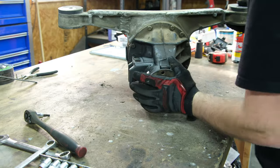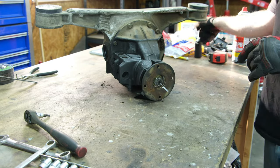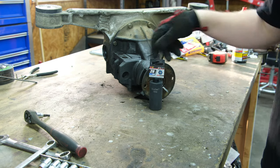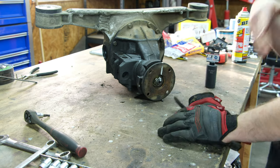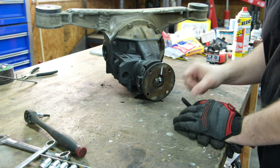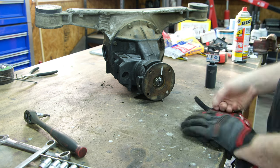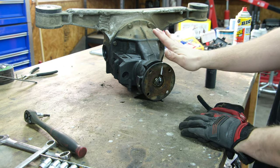All right, so back on to Big Bertha. I got a 26 millimeter socket from O'Reilly's, and it fits. So the plan is, once we put it back on, to not go past this paint mark inside the threads. It should be pretty easy to tell if we go past it. Obviously, this is not a technical way to put it back together, but it should be good enough. It will get us in the ballpark of where it was when it was in the car.